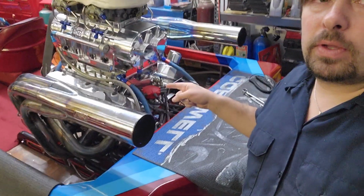But other than that, we got power to the gauges. That's all working. Got the new starter put on. That works. No issues there. I ended up tapping the key, and the starter cranks it over. I did not get carried away on cranking this over due to that this does not have oil in it and a filter on it yet. So hopefully by this weekend I get the oil, filter, and get my new valve covers on. Those are on their way.